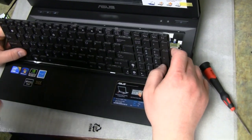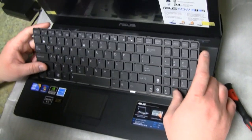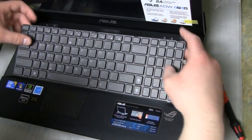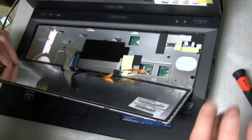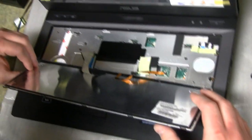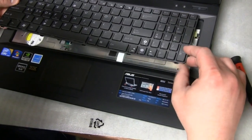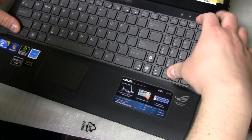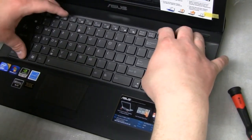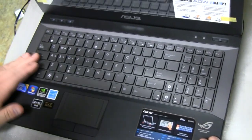Sometimes after doing this, I like to reconnect power and test that the keyboard backlighting is working. In your case it'll be a little easier since the machine will be running. You might just want to plug in power and turn it on once everything is connected. Don't connect power before connecting all wires, and make sure your battery is out and the machine is unplugged from power while doing all of this. Next, set the keyboard down — you see the little lips at the bottom that just fit into place. There are spots for each one. Make sure they're all down, then set the keyboard starting on the top right-hand side and move to the left. Now the keyboard is back in place.